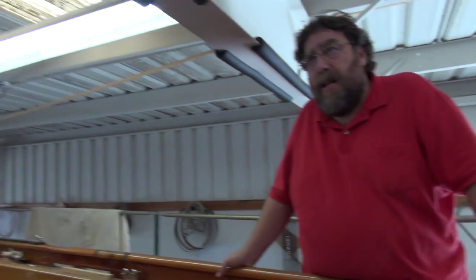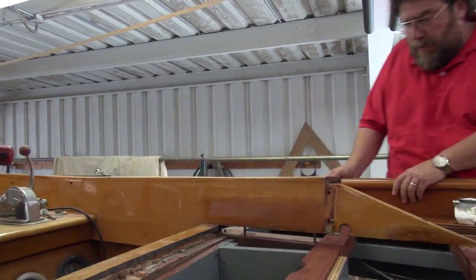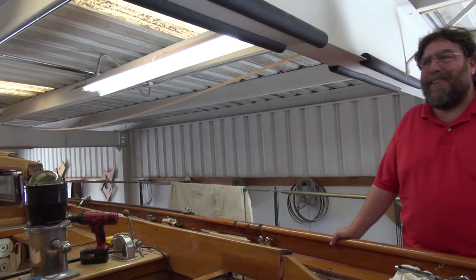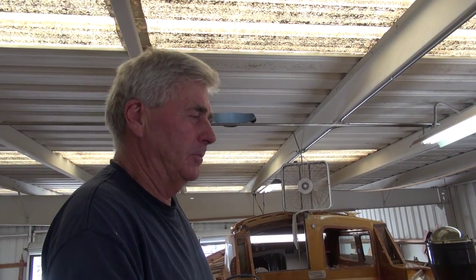Is there a drain in that tank? Yes, right here. There's a drain and it goes to a through-hole right out below the waterline. Is that to keep the propane from building up inside the compartment? If you look carefully at that through-hole, it's forward of the drain. That's the problem — which might explain why your tank's rusted. Right, it was forcing water in. Yes, if you go through the water. Right, we were going backwards a lot.